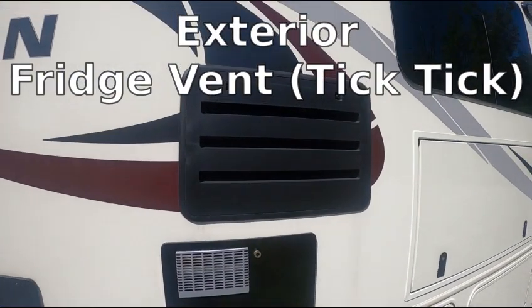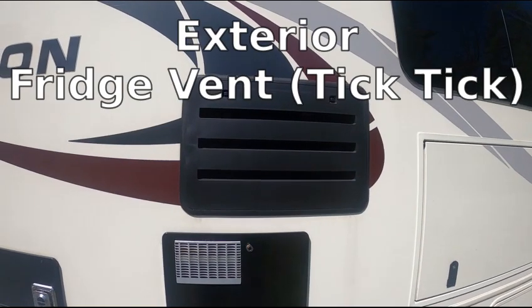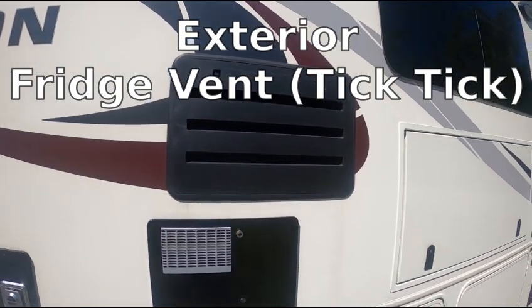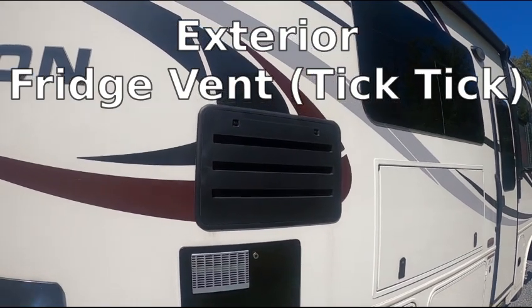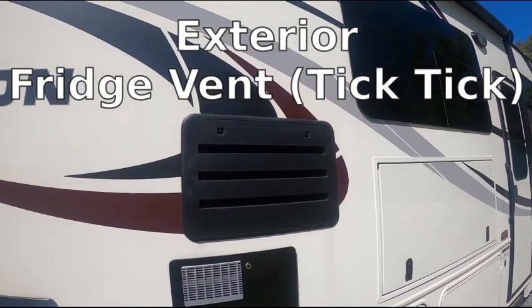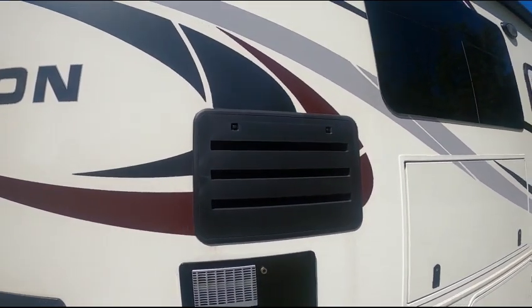Up top is the vent for the refrigerator. So what you will hear in there, if it's kicking over to travel mode, so to speak, for the fridge, you'll hear tick, tick, tick, tick, tick, tick, tick. It's not a time bomb. It's the refrigerator flipping over to propane, because it will run propane while you're on the road.